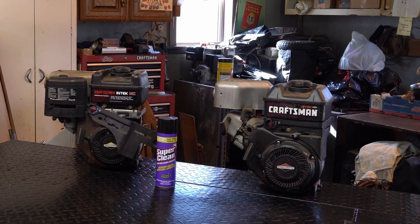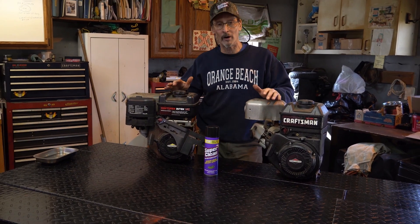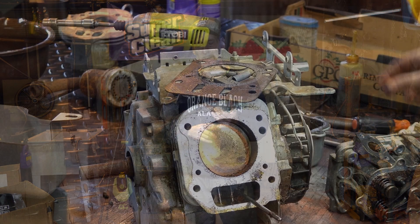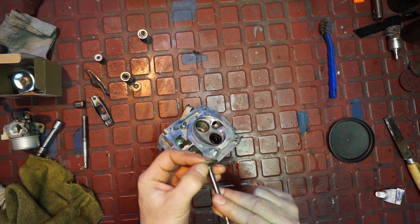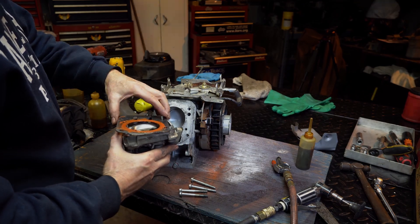They were both not functioning. One of them was completely rotted out, took on a lot of water into the motor. So I pulled the head off, I reconditioned the head — meaning I took the valves out, I lapped them back in, I cleaned everything up, I smoothed off all the surfaces, and then I put a new head gasket on. In the cylinder, we cleaned it out, we did a little bit of honing, got everything back together again, torqued that down, and we put a Walbro carburetor on it.